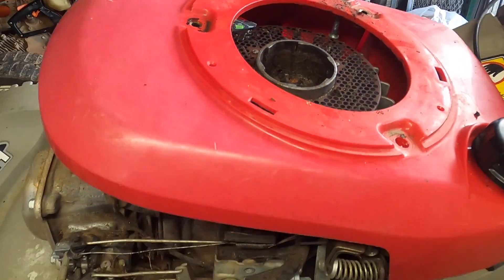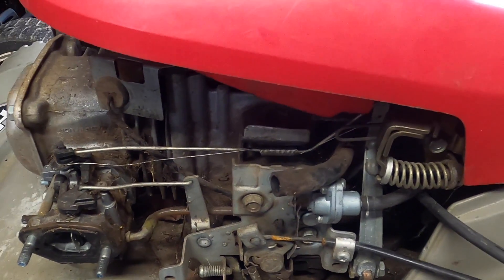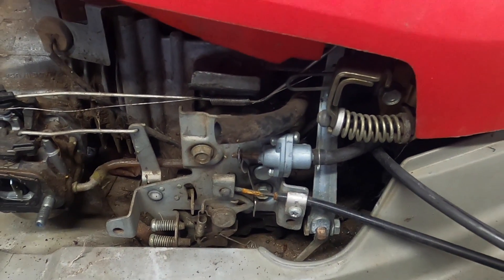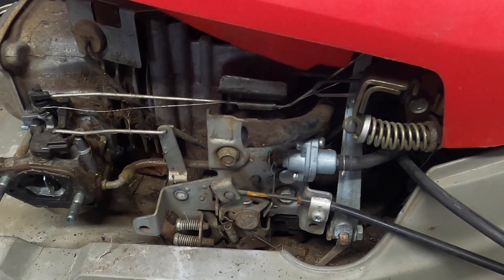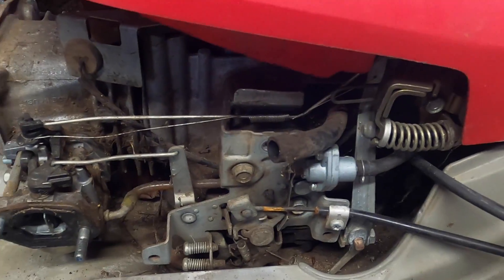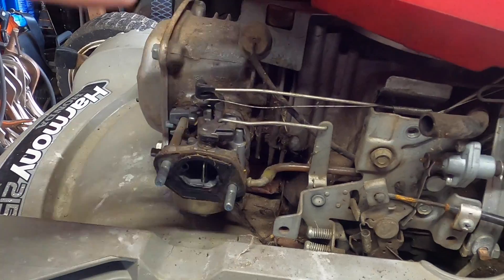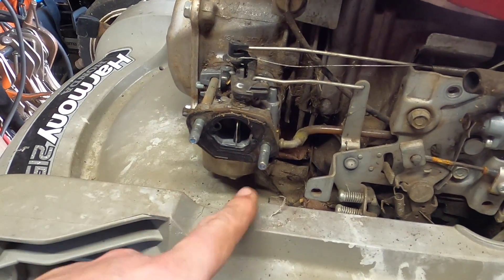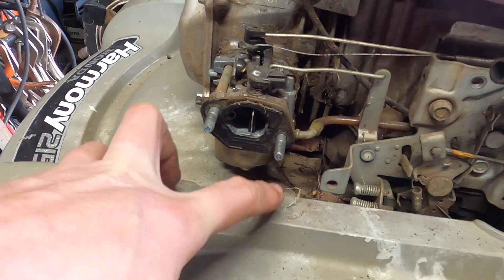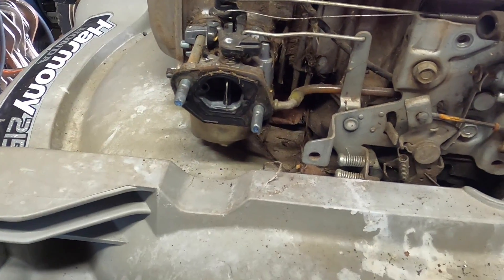I cleaned out the top — it's not perfect but it's better than it was. This is the fuel shutoff, but there's no nozzle or anything. So you end up having to do a little handle or knob, and it actually shuts it off for you. That's off, that's on — I'm sure you get the point. See this little cutout? When the carb and machine are put together, the carb can come out. Without it, this is too high and the bowl would actually get stuck. So they just carved it out — interesting little idea.